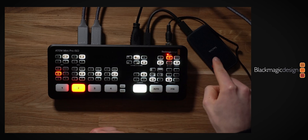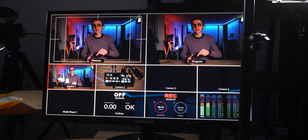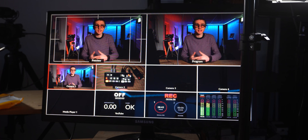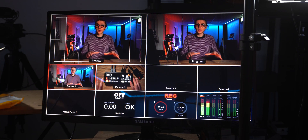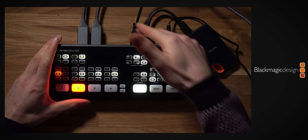I have an external SSD connected via the USB Type-C port into the back of the camera switcher, which allows me to record all of the camera switches I'm actioning by clicking the buttons, directly to this drive. I can then plug it into my computer later and edit with it. Not only can we control our live stream with the Blackmagic ATEM Mini Pro ISO, but we can also record a physical copy to repurpose that footage — for example, breaking long-format content into shorter clips for Instagram, Facebook, or highlight reels on YouTube to attract more viewers. We can still live stream via the network connection and simultaneously record via the USB Type-C to the external drive.